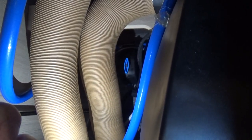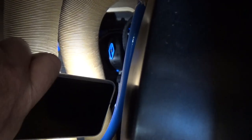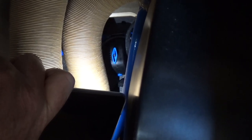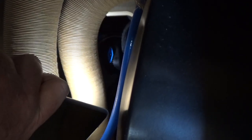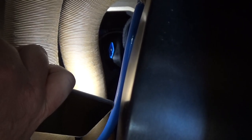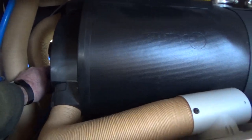Right, I've dug down between all the heater pipes and here is my frost valve - I've got a torch down there so we can see what we're doing. You can see it's in the drain position and the button's out as well, so what I have to do is turn that switch and press the button in. If it keeps popping out it means it's below three degrees, so I'll definitely need to warm the motorhome up. The button is still popping out so I definitely need to start the heater up to keep the water in the boiler.